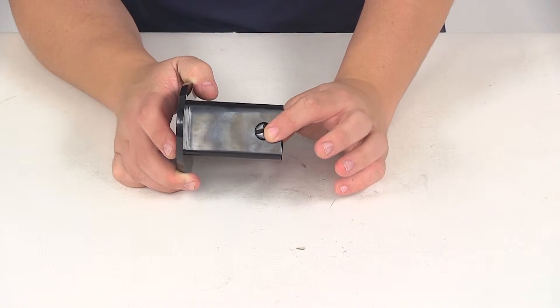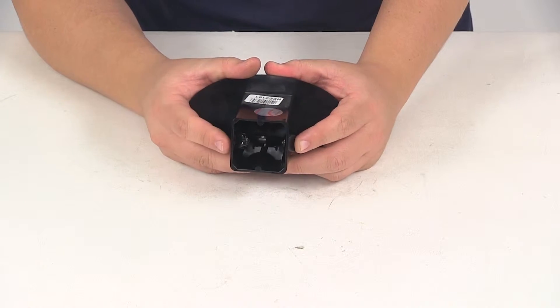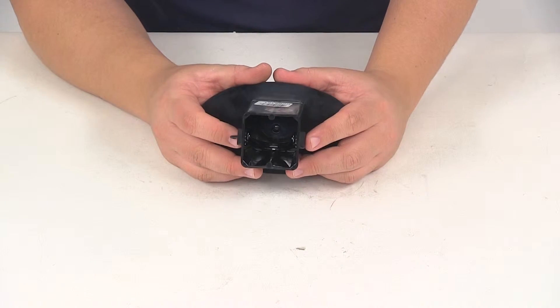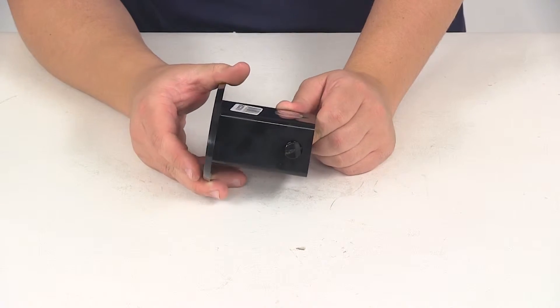You can see right here that it does include a hitch clip. As you slide in your hitch, this will go in, and then once you line up your pinholes it'll pop back out and engage the pinholes of your hitch. Now if you need a hitch lock, that is going to be sold separately and you can find them right here at eTrailer.com.